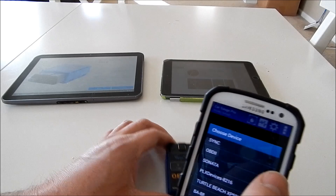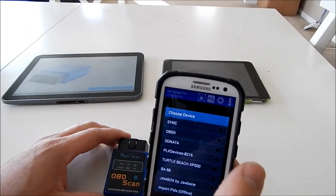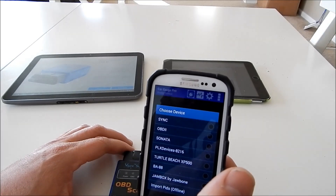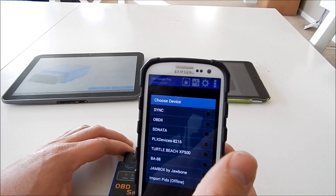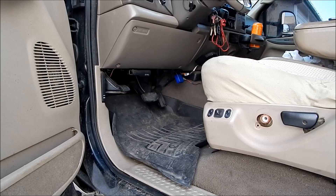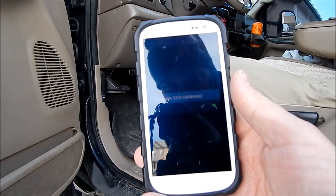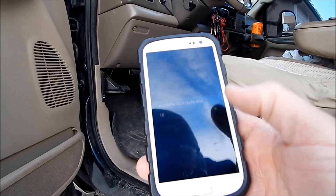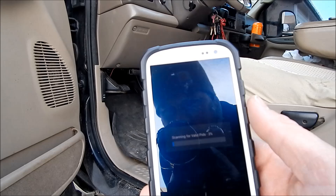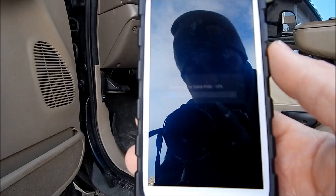My device is the OBD2, but it's not connected to my vehicle yet. I would choose this device. It takes about four minutes to go through that test, and then after going through that test, it unlocks a separate menu where you can then run the injector test. So after you go through the steps I showed inside, you'll come to this screen on the phone — it says available ECU address. Just click that and it'll say scanning for valid PIDs. This takes a long time.